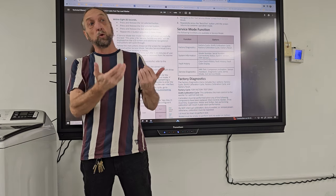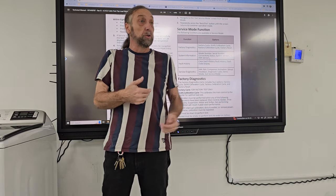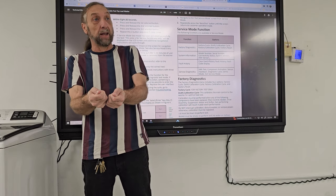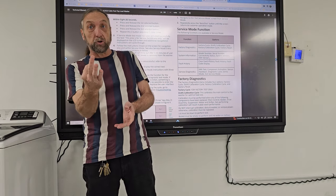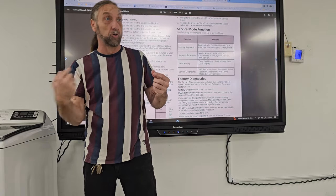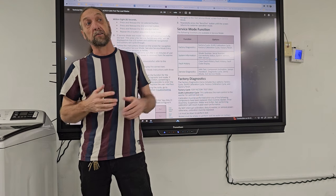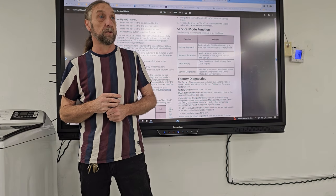So what you would do is you would sit there and wait and see if it reached temperature. What you would do is say, am I getting power to that element? Am I getting an amperage draw telling me that the element is working? Because if it's drawing electrical current, I know the heating element's working. So in that case, that's how you would use it for testing.